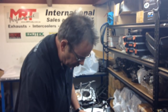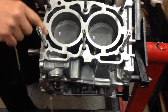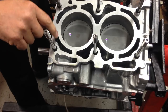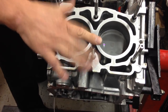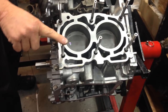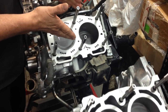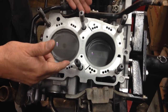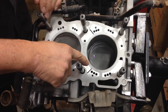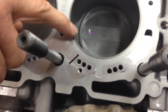Now take note of how thick the wall assembly is on this 2 litre engine at original factory standard. Remember, this is virgin — nothing's been modified other than just putting the bolts in place. Then have a look at the modified EJ207 which has been closed decked. We've had to take some of the material out to reline it, and this is actually an insert — it's not what you would normally call a liner.